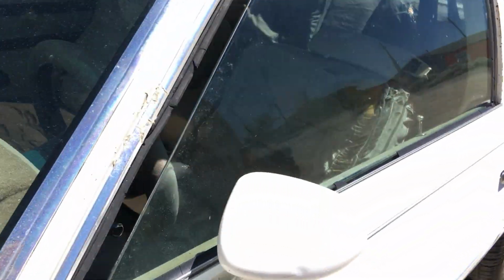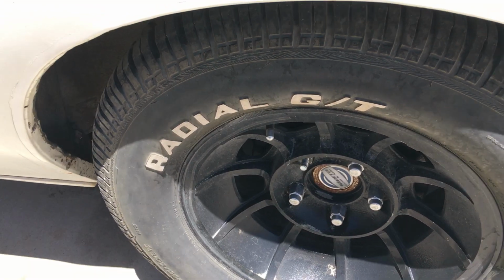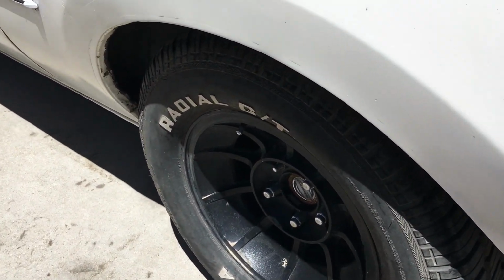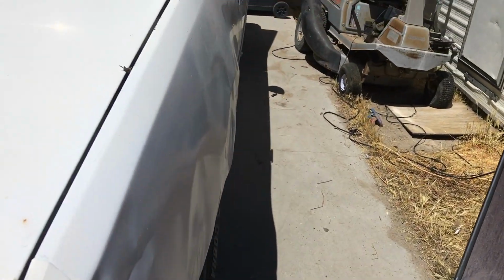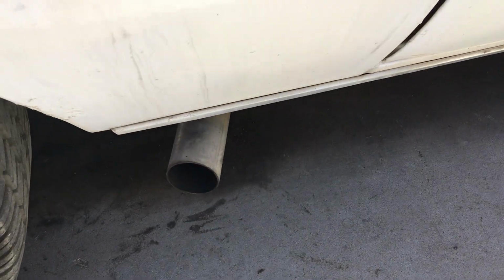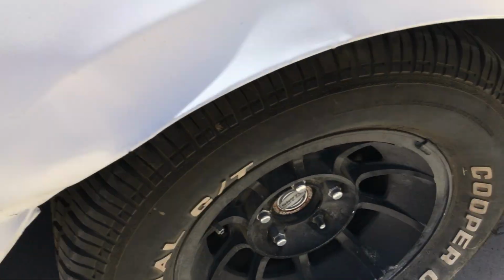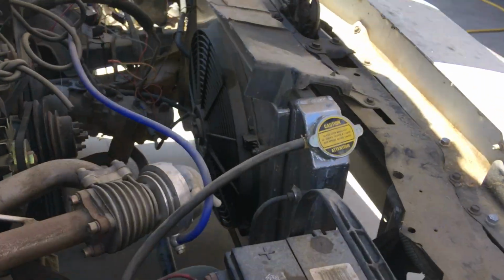I've also got a different radiator, nice performance radiator, aluminum with electric fan. So I just did some upgraded touches to it. I put my 87 Turbo T Limited Buick wheels on the 80 Sport Coupe. New strong high temp axles, high performance, high strength axles with an Auburn gear locker and 3.73 to 1 gears in the rear end, so it's much more responsive. It's got a side pipe exhaust instead of the original behind the axle exhaust. It's less curves, less bends, and more response, so it's an improvement. I've also got a glass pack instead of the original muffler, so the exhaust goes quite freely through this setup.